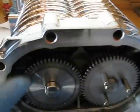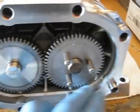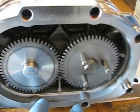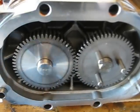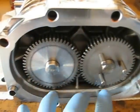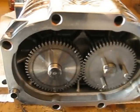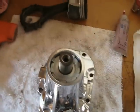On a Gen 5 supercharger, none of the bolts get Loctited except for the two bottom ones. The reason being, for whatever reason, it'll leak — it'll start seeping supercharger oil out because this is a wet bath in here for those gears. So you've got to seal those two bottom ones. On a Gen 3, you don't have to seal any of the threaded bolts whatsoever, just these two bottom center ones on a Gen 5. And that's it — hope it helps.